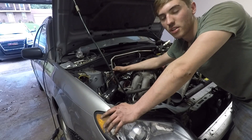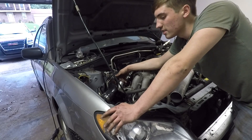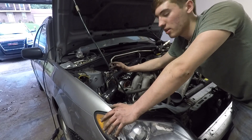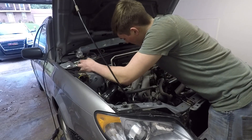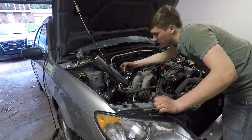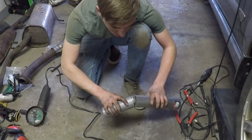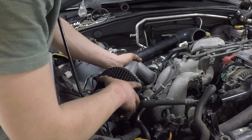The last part of turbocharging my non-turbo Subaru is making the inlet pipe — that's the pipe the air filter is going to be attached to, as well as a couple of vacuum lines, the valve cover breathers, the brake booster, and anything that needs vacuum to work. I'm going to have to put this in there, cut it at an angle, and then weld it so that the air filter is sitting right around here. Let's mark this out the best I can. That's actually not too bad for eyeballing it, but I don't think the angle is enough — definitely need more angle. Many more cuts later — yeah, that looks pretty good. Definitely looks better. Let's weld it.